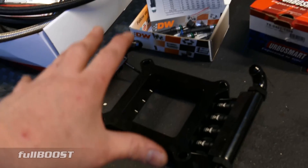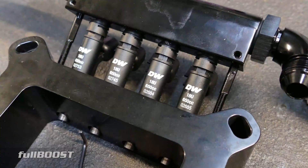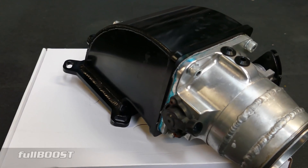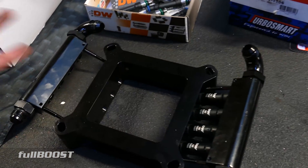The next part is getting it into the engine. An easy way to do it is one of these adapters. If you've got a 4150 base plate manifold, bolt one of these on, bolt a neck like this on — or a 4150 throttle body on top — air will come in, go through, fuel comes in, happy days, you've done it.